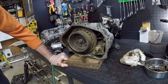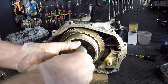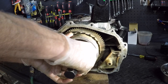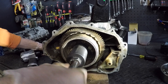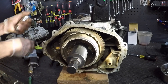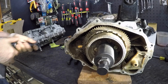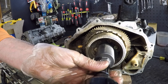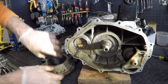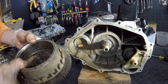And a flywheel puller - looks pretty rusty. Got that from Watercraft Superstore. It's on there pretty good; this is reverse thread. That came off nice - okay, that thing was worth its weight in gold. Lots of cleaning to do there.